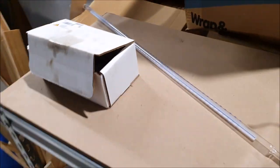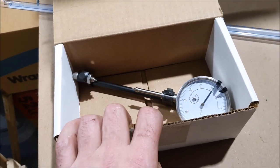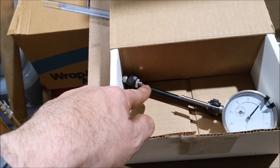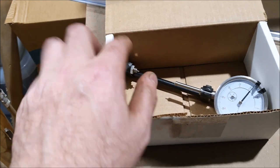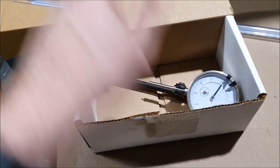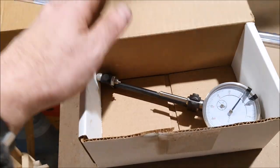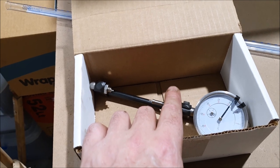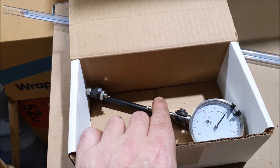The other two tools that have turned up: one is a bolt stretch gauge so I can measure the big end bolts. I may turn up a slightly longer bolt with a pin for this end, because it just gets caught up on the bottom of the conrod — the pin needs to be a little bit longer. This is just an M6 thread. It came from Summit Racing in the States. They also sent their catalog, which is fascinating reading — just seeing how much US car stuff is available at ridiculously cheap prices.